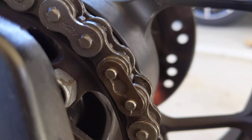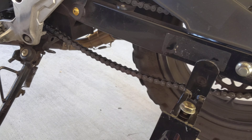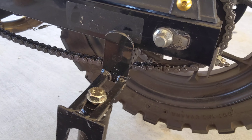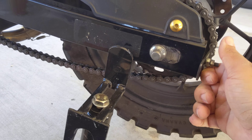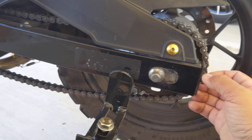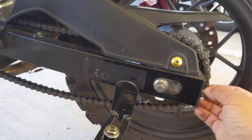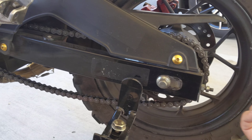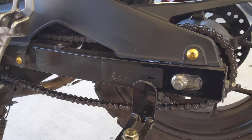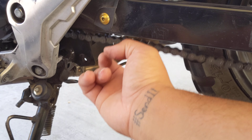As you can see, it's connected. Everything there — that little gap has been closed and we are now good to go. Obviously we have a lot of slack, so we need to move the axle back. I'll adjust that right now. At this point it's just adjusting the axle to reduce slack, as any other chain adjustment would be. That is a brand new chain on — so now it's literally just a chain adjustment.